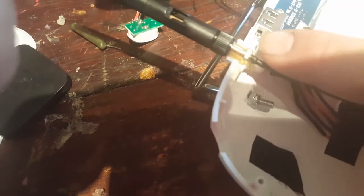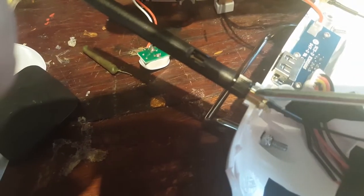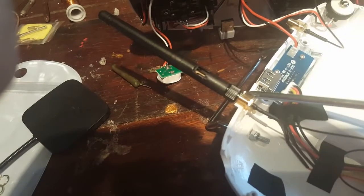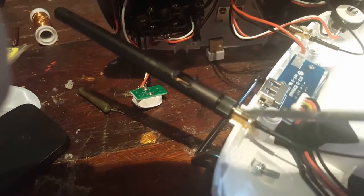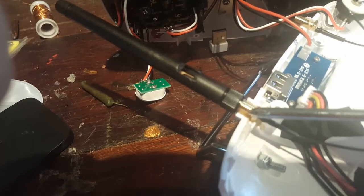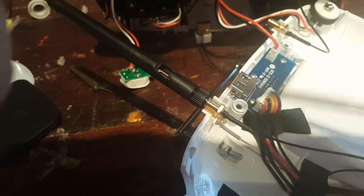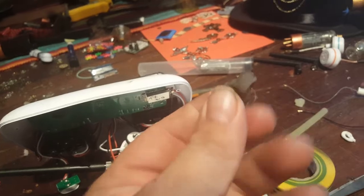What I like to do is get some liquid metal two-part epoxy, roll it together, fill up this little cavity here, and let it sit. When the top case goes back on it's snug as a bug — the nut is permanently locked in. If you want to change back to your originals, just pop it out and slap your original ones back in. Too easy.